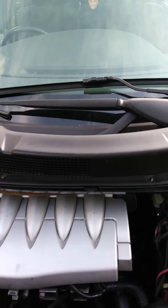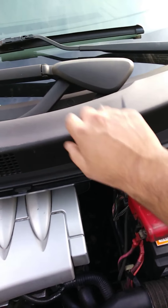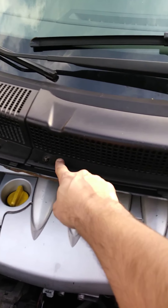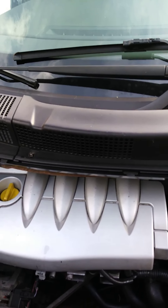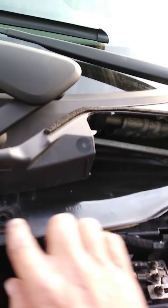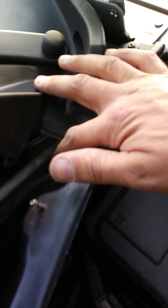On the MK2, I want to change the air filter. The air filter is located behind the ECU, behind the battery. You have to remove three 10mm bolts — one, two, and three — and they're plastic, so be very careful with those. It unclips like so. There is also a metal heat shield along here which has a 10mm bolt there and one here as well, so that can come off too.